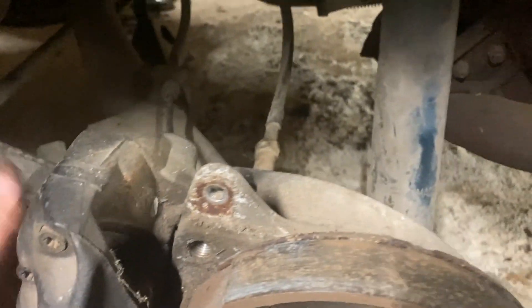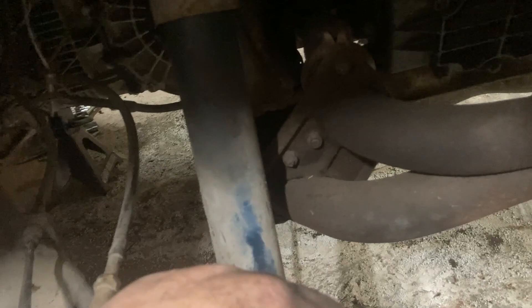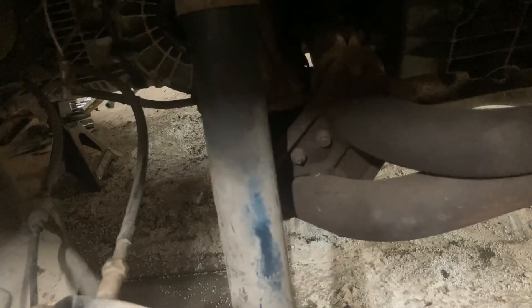Someone had driven those bolts in or tightened them down with lock nuts — it was a nightmare. On the calipers, one has the correct bottom bolt but the other rear caliper did not. The starter bolts have the round nuts with the Allen head inside, and the top one is wallowed out and stripped, so I can't get the starter off until the motor and transmission come down. I spent about an hour trying to get that nut off before I finally figured out why. It's been like that everywhere — mismatched hardware, mismatched bolts and nuts — so a 30-minute job takes three days.